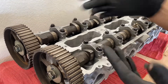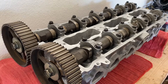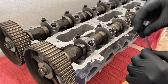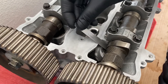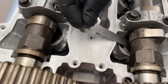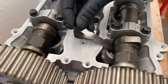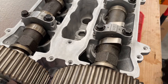On the intake side the gap needs to be six thousandths of an inch to ten thousandths of an inch. I like to start with one that's just larger than the maximum tolerance — the maximum is ten thousandths — so I'll grab eleven thousandths and it should not fit. I'm placing it barely under here between the top of the shim and the cam lobe. It does not fit, so I'm good there. I go down to ten thousandths — that one does not fit either, and I could still be good since the range is six to ten thousandths.